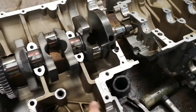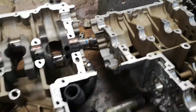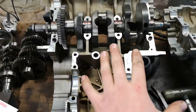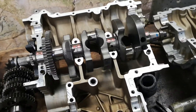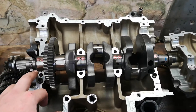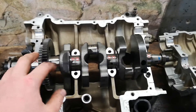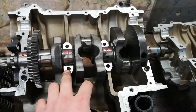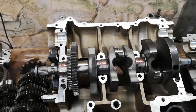These have been out and had a good run through the parts washer - the two crankcases - and I've started building up the selector forks already. I didn't want to build up any more until I was sure about the shell bearing selection, so I used the manual which I found online, measured the internals, measured the crank with a micrometer.